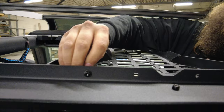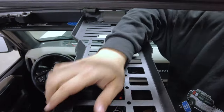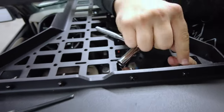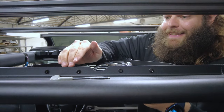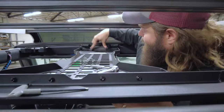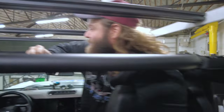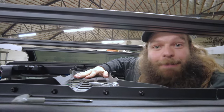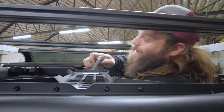It's like a jungle gym in here. Hold up on it - thank you buddy. You need a buddy for this install - buddy needed. We've got our four rear bolts in. It's a 10mm and a 4mm hex. Got these tight. Now tighten up the two front-most bolts, then I know exactly where it's going to line up centered in the Bronco. Tighten down the four others and you're done - start mounting your accessories.